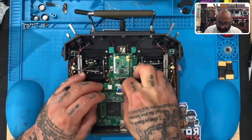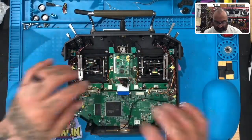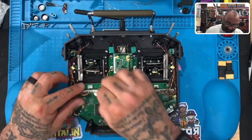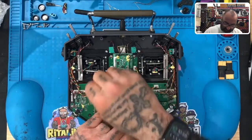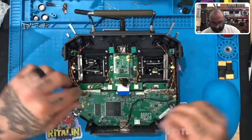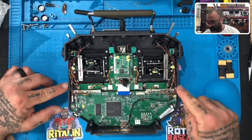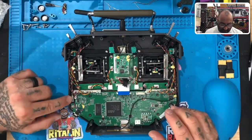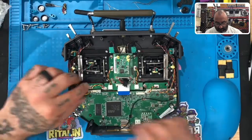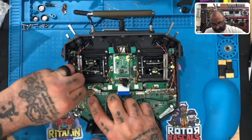Go ahead and get ready to take the ribbon cable out. Flip this piece up and gently pull that cable out — just leave it like that, don't kink it. You can take the plug out from this side. Pay attention — these plugs tuck into little indention clips. Also note where your small vibration motor wire goes — gently pull those out.